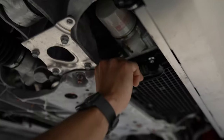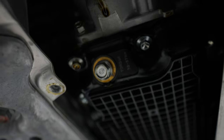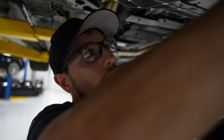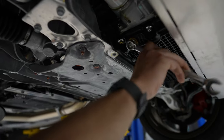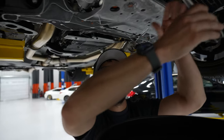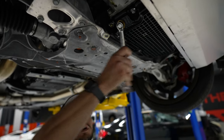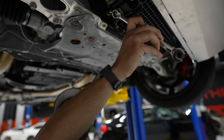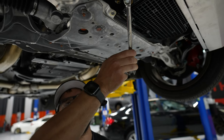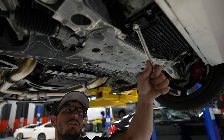Got our drain plug — it's down to a drip, so install it. There is a torque spec on here; I don't typically follow that, but I've been doing this long enough that I have a pretty good feel for how tight is tight enough. You want to be at the right angle where you see the gasket has crush — it's flattening. Once it's flattened all the way and you start to get a little bit of tension, just snug it up. You want to make sure it's not going to fall out, but also that the gasket is good and sealed up, crushed nice and flat.